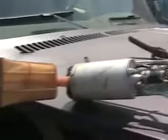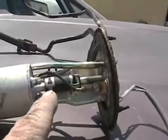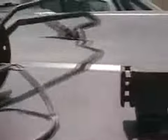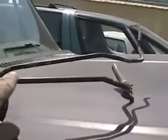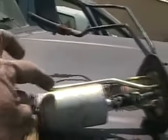It all starts with a fuel pump that's usually found inside your gas tank. There's a strainer filter on the end. Some have a one-way valve there that maintains the fuel pressure in the system after the car is turned off. The larger tube is the fuel output that goes to your injection system; the skinnier tube is your return tube that puts the extra fuel back in your tank, and it just goes to a dead end and dribbles out.